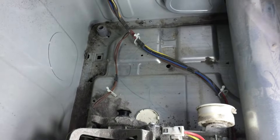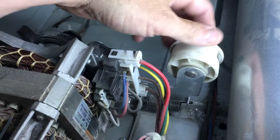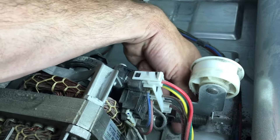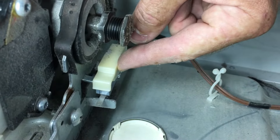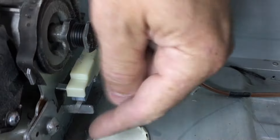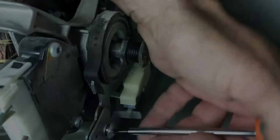We need to remember to put the new belt on before we put the drum back in. First item we'll tackle is the pulley. The only tool we've ever used on this machine is a Phillips number two screwdriver. With no belt tension, the spring is fairly easy to release. One thing to note: there is a limit switch here. If your belt were to break, it trips this to stop the motor from running — so another reason your dryer may not run is because this switch is tripped due to a broken belt. When we reinstall the new one, we need to make sure that arm does exactly the same thing, and the spring is connected right.